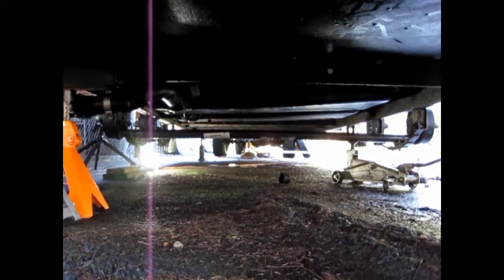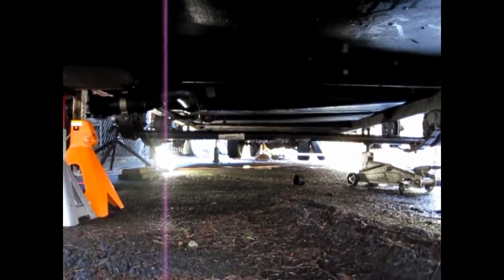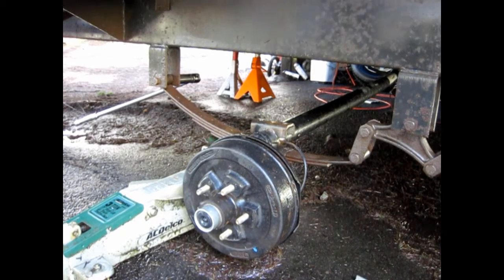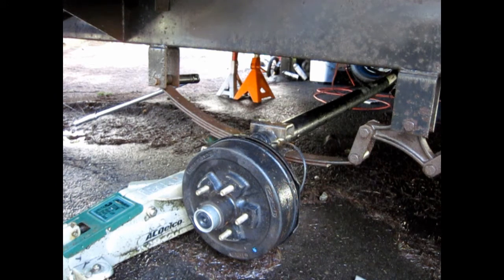Sure enough, those axles are cambered. The middle point of the axle is raised up and the left and right sides are drooping down, which means this thing has a little bit of positive camber. Just so you know, if you're an idiot like me and you remove the leaf spring plates, the axle is not secured to the leaf spring anymore, so if you go fiddling around with this thing your axle is going to flop over — if your axle is set up like mine where the axle tube is down below the hubs. Luckily, this thing was raised up high enough that it didn't hit the ground, so my brake drum should still be fine.